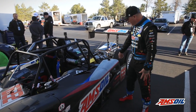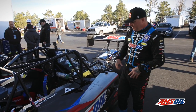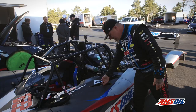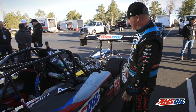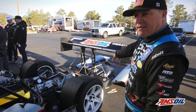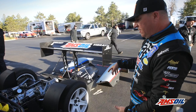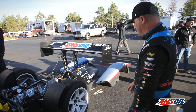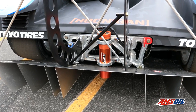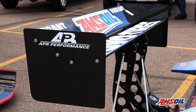The air exits out of here and back here. We've also cut some extra holes — like this — to let the radiator vent a little more. You can see how the cowl there swoops down into the cowling on the body, which creates a low-pressure system behind the car so the diffuser can work. It's got a big giant diffuser here and a twin-element APR wing — it's all made to keep the thing down on the ground.